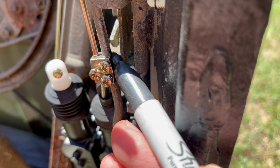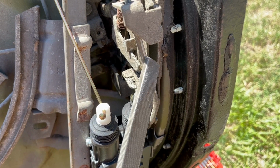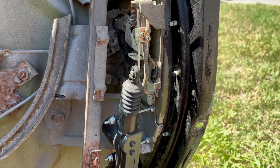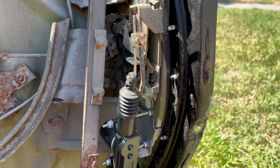A lock motor that's doing this is just going to try to jam up on the way up and down. It needs to be doing this, and whatever you need to do bend-wise to get it to do this, you do. Go ahead and mark it with a Sharpie, take out your file, and smooth one part of your lock rod down so you got a flat face. In my experience, the screws seem to bite in a lot better on a flat portion of the rod than a round one. Also, give her a little dollop of Loctite. Then go ahead and connect your wires up and test her out. You're looking for a smooth action and not a lot of movement from your lock motor.